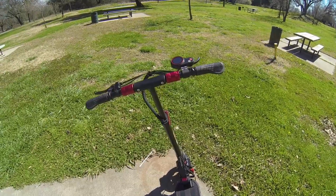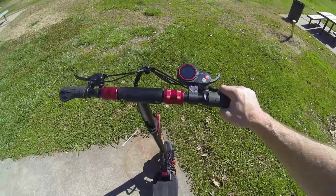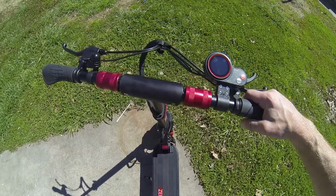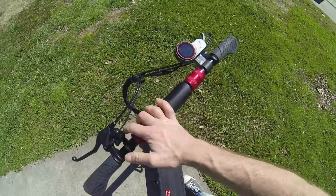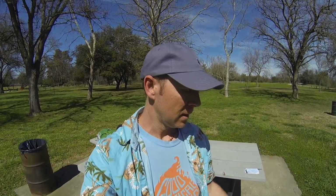There's gonna be a full write-up of specs down in the description, links and measurements that I took. So here, I wanted to show you that. You get rotation to the right of 60 degrees, and then we're stopping there, but to the left, I measured this at 75 degrees. So that's not 90, which a lot of people think is a bad number, because then your chances of flipping off of the scooter are pretty high.